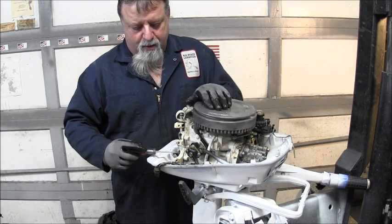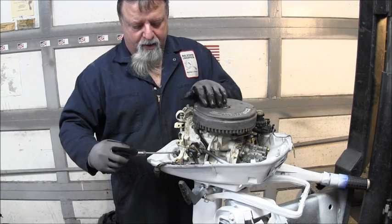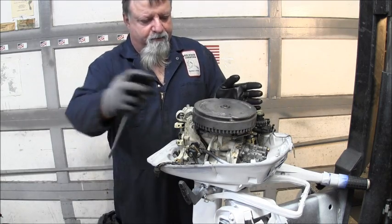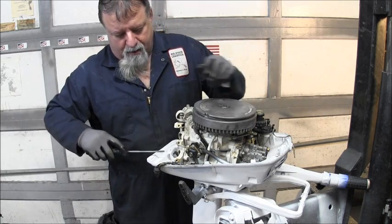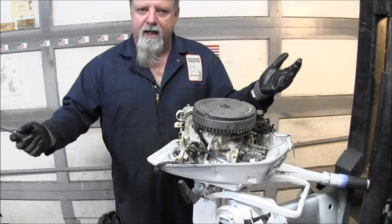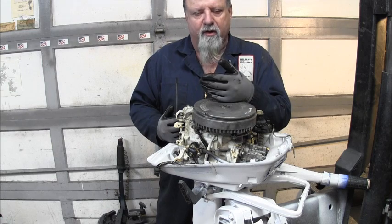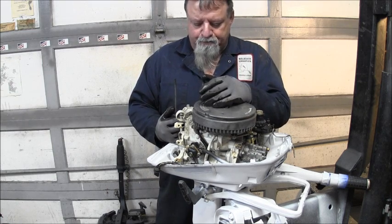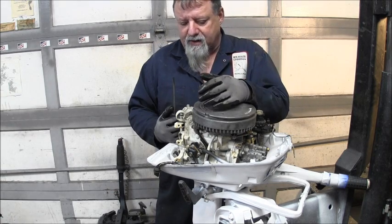Okay, here's the bottom. We're coming up, coming up, coming up. Starting to go back down. Stretch that piston out good. Get your screwdriver, put it on top of the piston. And again, I heard no noise. So the lash on these two pistons and the con rods and the journals and everything are fine. It was probably just the rattle and the shaking in my tank and so forth.